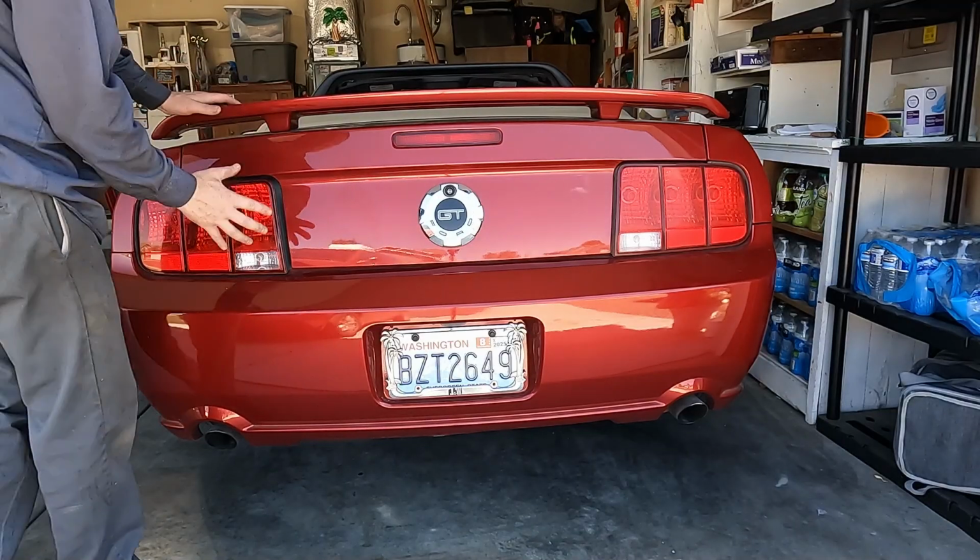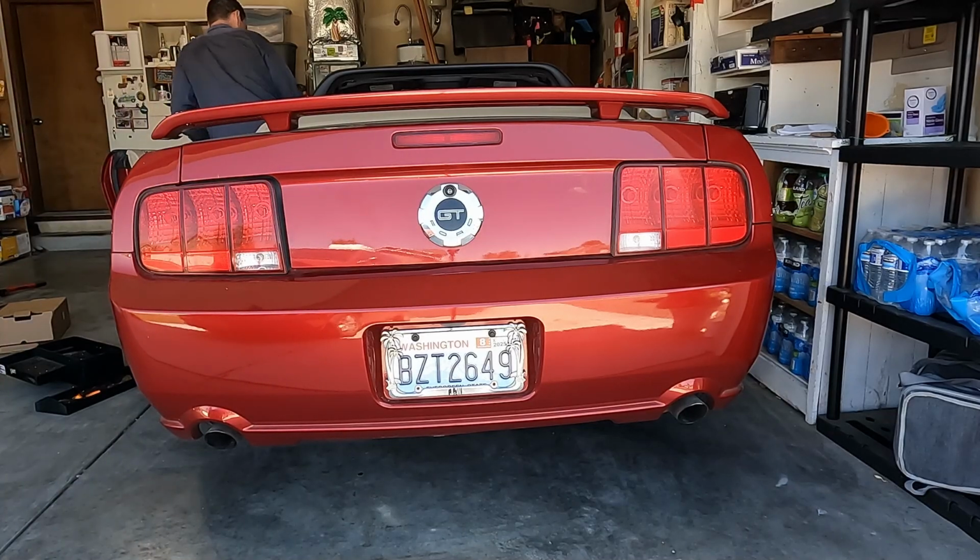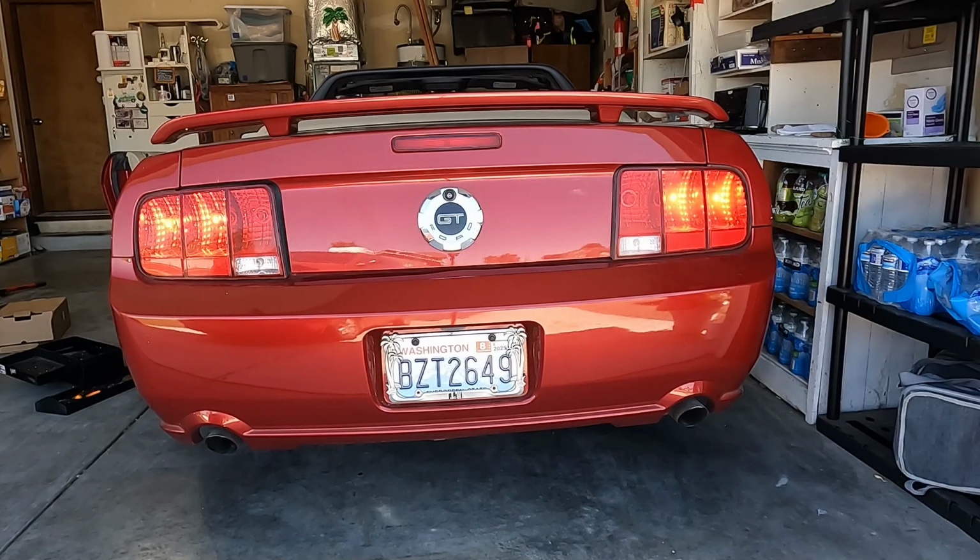First, that brake switch. If the brake switch is faulty, then it may not let the computer know that your brakes are even being applied. So that's an easy test. All we have to do is go in the back, have somebody push on the brakes, do our brake lights light up. So let's do that first. I'm gonna go in, push on the brakes, and we just wanna see, are our brake lights turning on? Here we go, brake on, brake off, brake on, brake off.